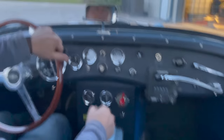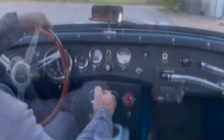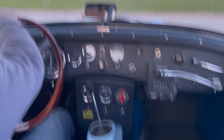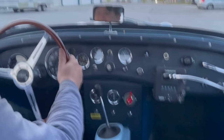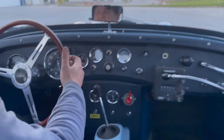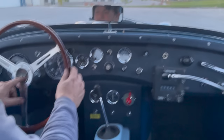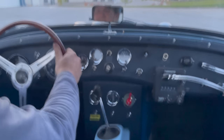There's a big mess in the shop right now because it's a bunch of stuff that Ken's going to be taking out to California. The steering wheel's not held in right now — I need to make sure that we're driving straight. Brakes do work. So now I'll take the steering wheel off and center that, then put the nut back on so I know the alignment is right and the steering wheel is straight going down the road.